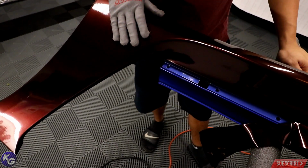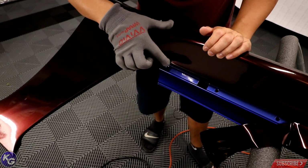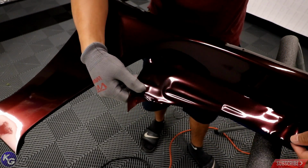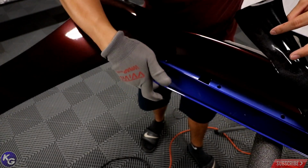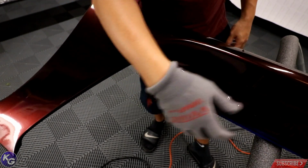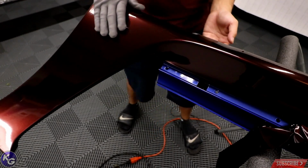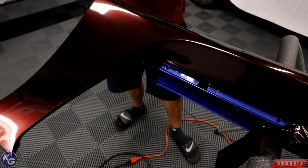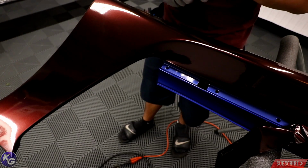Alright, so now that that's done, I'm going to go ahead and finish up this side skirt. Like I said, I'm going to copy the same method here. I'm going to trim 1/8 of an inch all the way down, and I'm going to pull up the extra piece and try to wrap the other part. Not black, I'm sorry, the blue part of the side skirt. So it'll be like this, and then in between will be the rubber skirt or rubber seal. And of course with the edge down here on the bottom, you don't really see this at all. So I'm going to wrap about 1 inch in and then trim it. Don't really have to care about that. And towards the end of this whole entire install, I'm going to work on my corners. So hopefully this turns out pretty nicely.